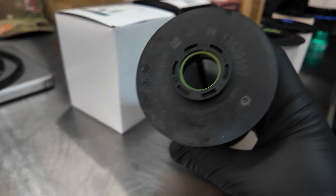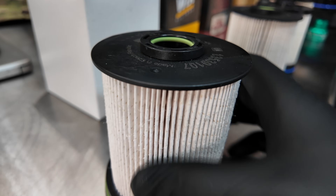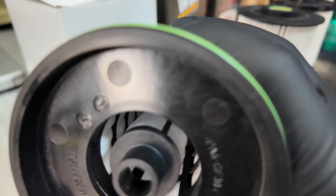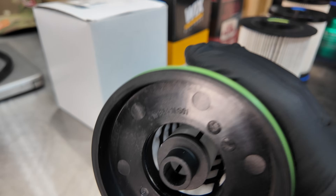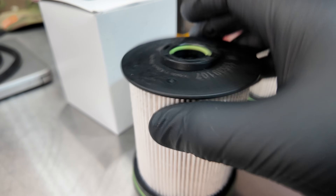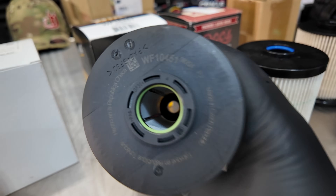This filter is made by Mann and Hummel, which is a name we'll talk about a lot in this video. The fuel flows through the filter media right here, comes out through there, and then through that screen you see there — that's where the fuel travels in order to come out the top of the fuel filter. Water is actually not going to be able to transfer through that screen material, so that's what allows it to separate the water, and the water stays down below. When we go over to the Wix fuel filter, this is also made by Mann and Hummel.